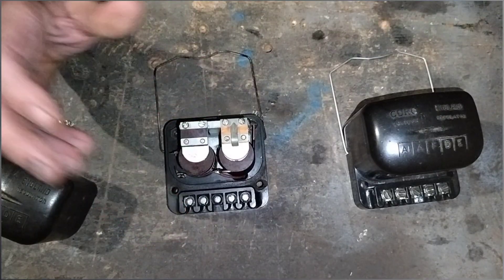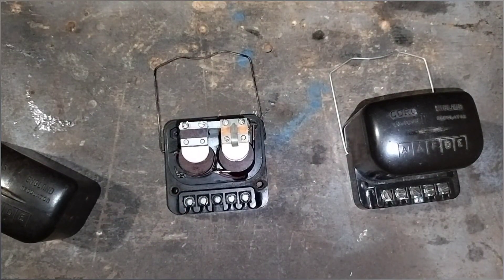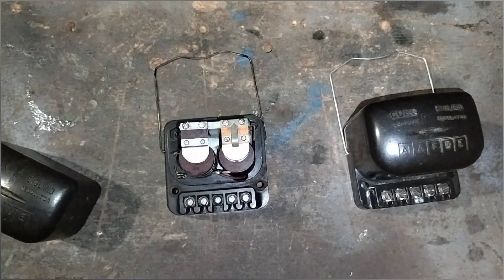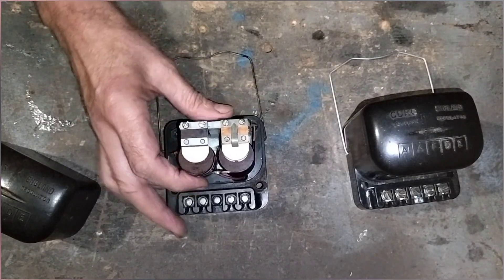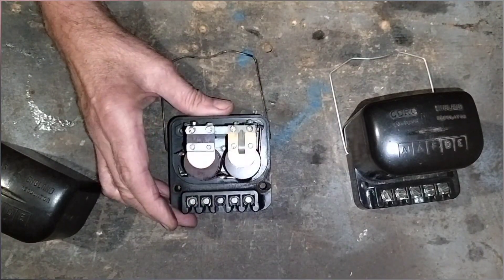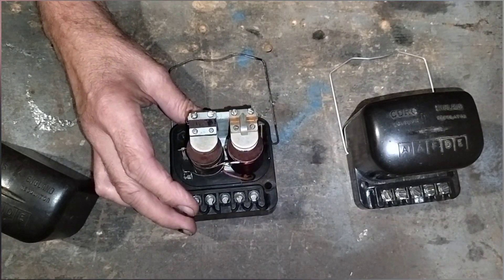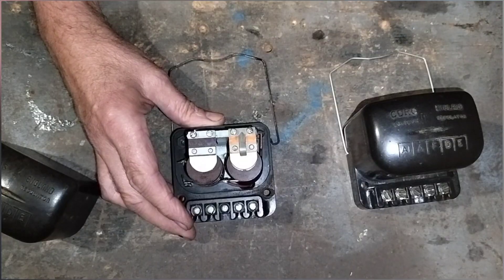So what are the choices? You can get rid of your control box and fit an alternator — the alternator has its own voltage regulator inside, so the control box simply becomes a terminal connection and ceases to work. The other option is you can buy a cheap reproduction control box, which are around 50 to 70 quid from most Morris Minor parts suppliers. They look alright, but they're poor quality — the plastic's rubbish, the copper windings aren't very good, the connections and insulators aren't very good, and they will fail.